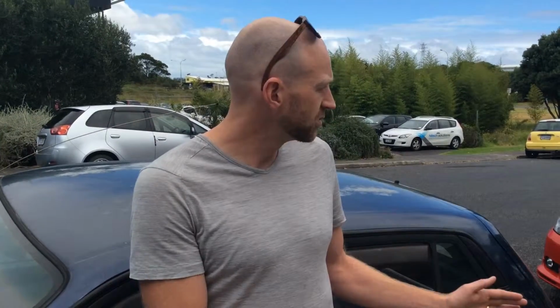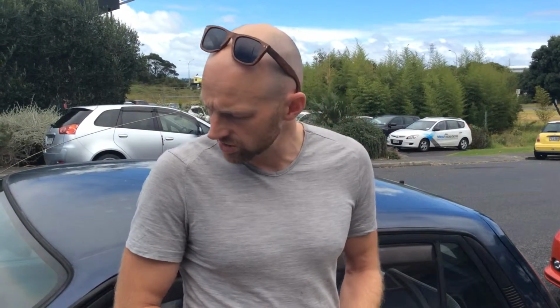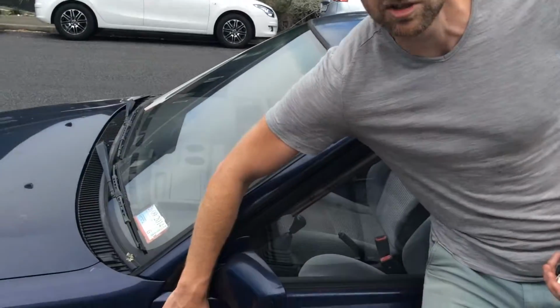And he made a few other pointers, just the real freebies. Taking weight out of your car. His point was every 50 kgs in a car is about 1% of its fuel use over a year, so you might save about $50 a year. And the other thing was the tyres, keeping them pumped up to the specifications, which are usually printed on the inside of the door. Keeping those tyres pumped up means you roll a lot better, it's less friction, and you use less fuel, which is good for us, good for the planet, and hopefully saves us a bit of money at the end of the year.